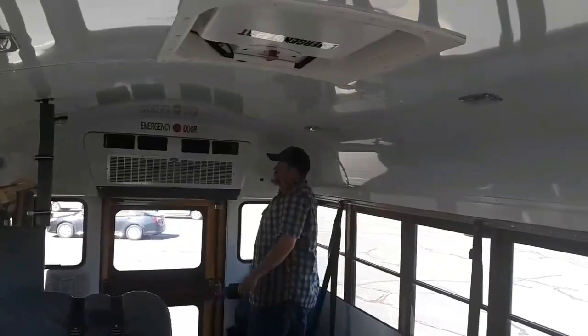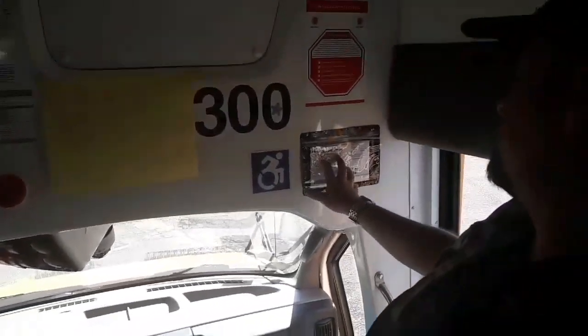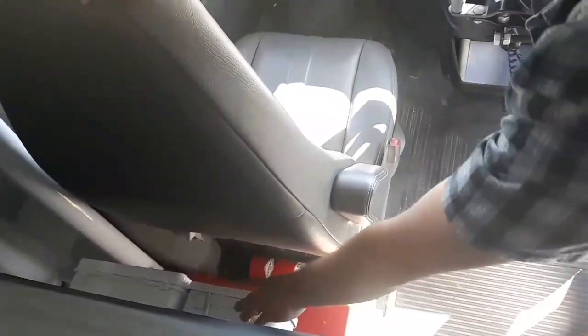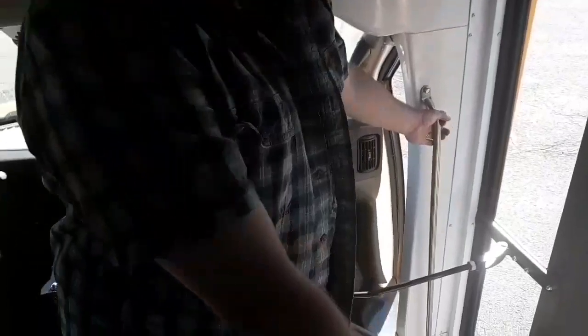I'm going to go back and reset the no-sleeping-children alarm. My registration and insurance paperwork are in place and up to date. My handicap sticker is in place and not peeling. Because this is a handicap bus, I have four pieces of emergency equipment: my fire extinguisher, which is fully charged to the green, not expired, and secure; my three reflective triangles, which are secure; my first aid kit with three spare electrical fuses; and my fire blanket, which is 35 square feet. They're all secure. My handrails are secure with no loose or missing parts. My step lines and standee line are secure and not a trip hazard.